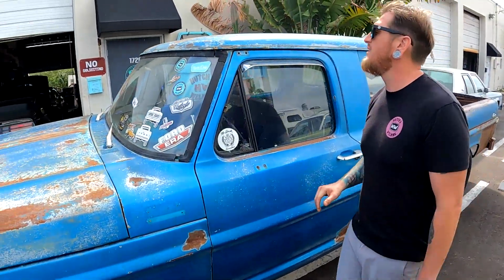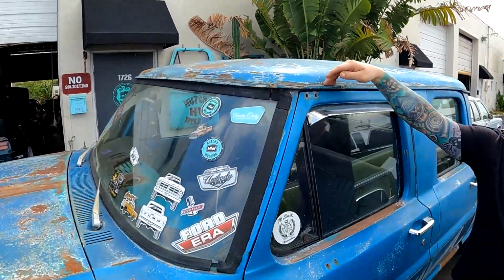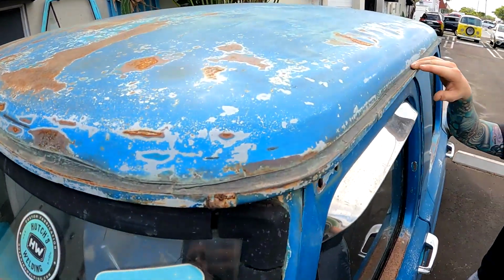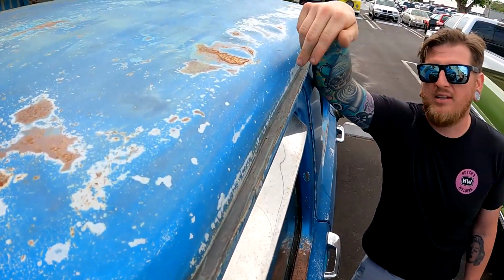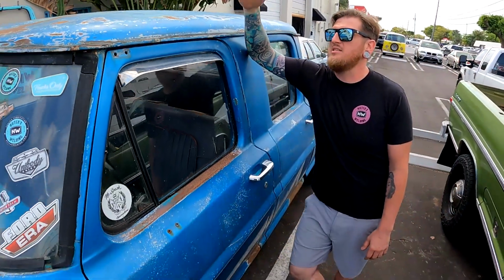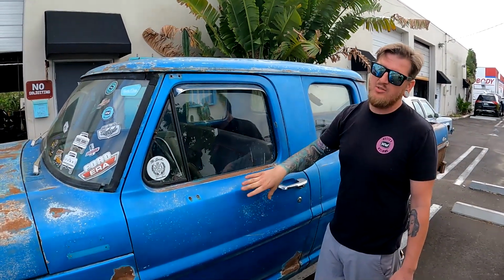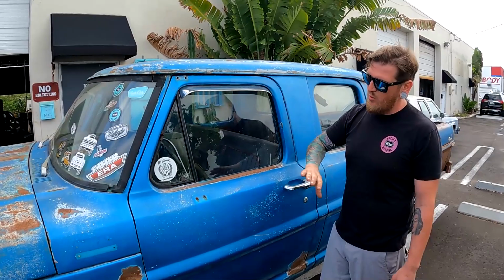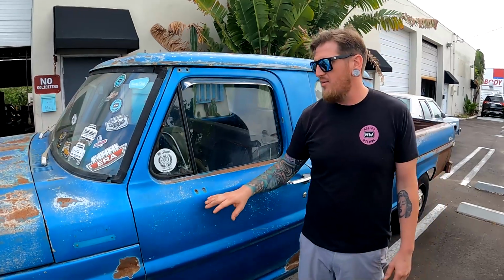Stay tuned for that. Another thing that we did is we sealed the roof. As you can see here, we did a seam sealer along it. If you look up Chuck C, I'll put a link down in the description for you. He's got a really good write-up on buffing patina, because that's actually what we're gonna do with this: we're gonna wet sand and buff this. Just kind of protect the patina. We don't want it to get any worse. We want to get a lot of the crap off, but we do want to wet sand it. So he's got a really good video on that.